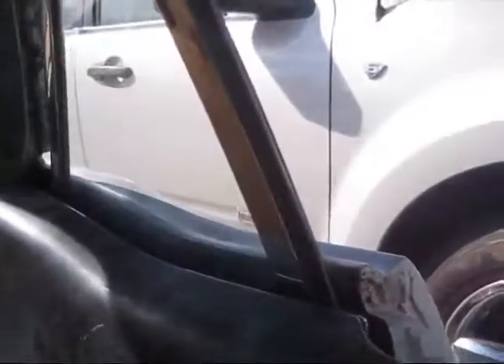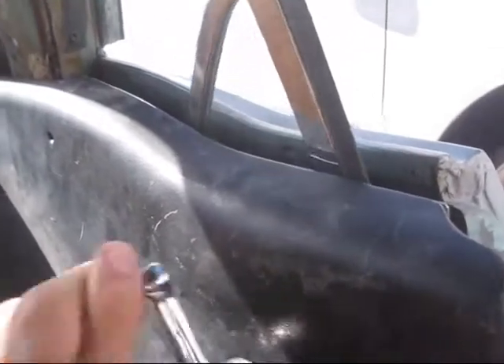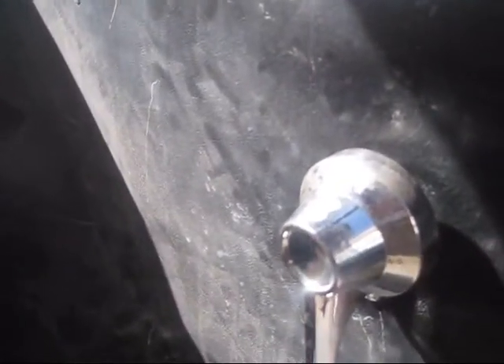I also got my rear windows rolling up and down. I originally had these bolted in because I was going to run air ducts from the side scoops to cool the rear brakes, but now that I'm doing disc brakes I'm not really going to worry about it — disc brakes don't really need extra ventilation unless you're road racing. So I'm not doing side scoops or the air ducts. I put the regulators back in, got them all adjusted, and did the same thing on both sides.